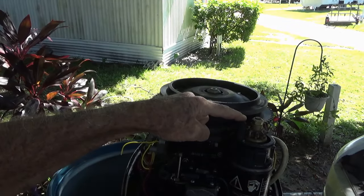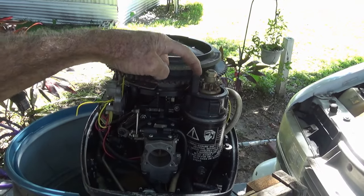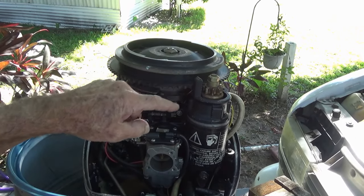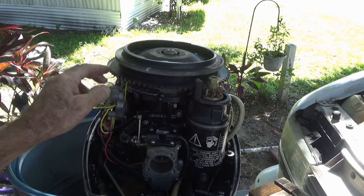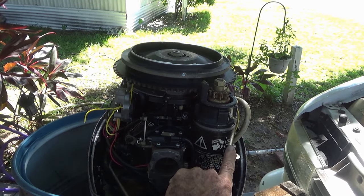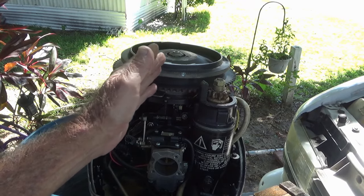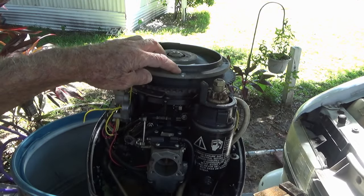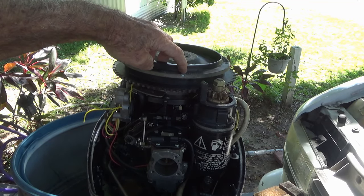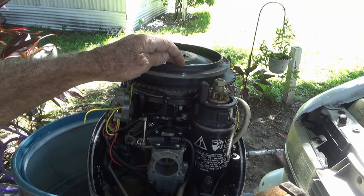See right here, this is your mark for top, for timing, right on top of there. Anywhere within that little humpity spot, give or take 1 or 2 degrees. So anyway, this was set at 30, according to here. And with Joe Reeves, you want to go backwards 4 degrees. So it went back, 30's up here, went 2, 4, back to 26. Okay, so I marked it with a little white paint on the Q-tip.